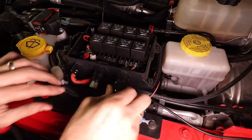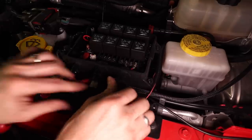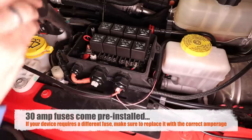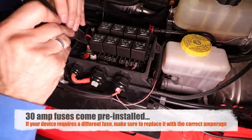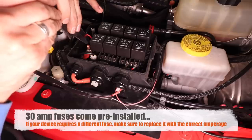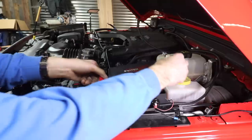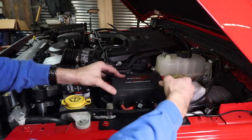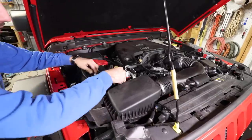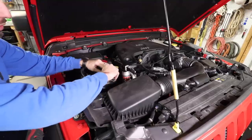That's all the things I'm going to hook up for right now, and we'll hook up the rest later. Since we hooked up this wire and we want everything to shut off when the engine shuts off, we're going to switch this little switch down here — there's two switches, one and two — and we're going to switch number two to on. Now the cover can go back on there. After we clean up our wires in the engine bay, we can go ahead and reconnect our negative battery terminal, and then we are finished in the engine bay.